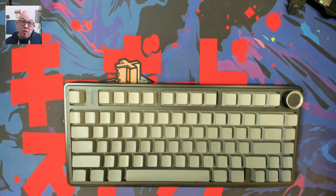The chin sits at 22.5 millimeters from the typing surface, while the back sits at 31.5 millimeters, providing a default typing angle of 7 degrees. Flipping down the first set of included fold-out feet will raise the back height to 36 millimeters, changing your typing angle to 9 degrees. Flipping down the final set of fold-out feet will take the back height to 44 millimeters and your typing angle to 13 degrees. This keyboard's MSRP is $79.99, but it goes on sale quite regularly at well below that.